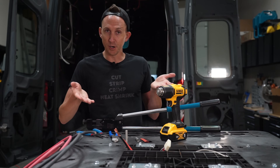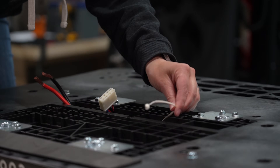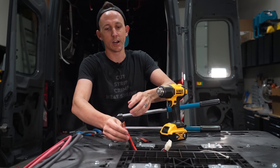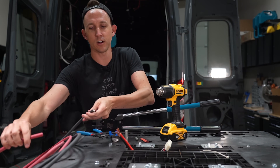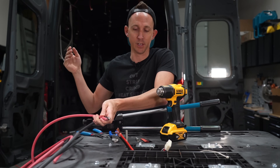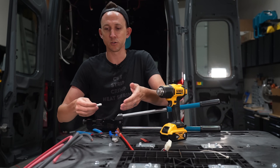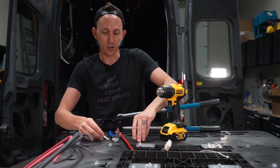We got the air conditioner flipped over and Stephanie pulled the wires out of the bottom of the air conditioner — a little data cable, more wires for the control panel, and then the two big power wires that are actually going to deliver power to the air conditioner. So we want to connect our positive and negative wires that are going to the Lynx distributor later on in the build to these two wires. We're going to use butt splice connectors and crimp them onto the wires, then finish it off with some heat shrink.